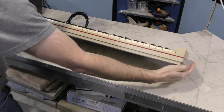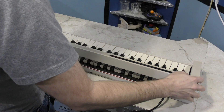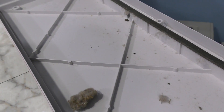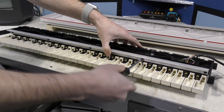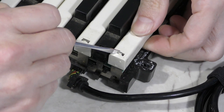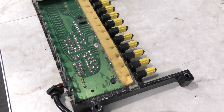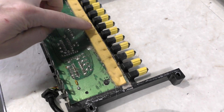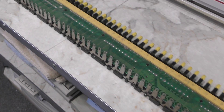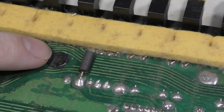But before I do that, there's one other problem to tackle. I'm going to take the keyboard unit apart and see if I can clean the contacts inside. It's pretty easy to take apart — there are just a few Phillips screws on the bottom. The top piece comes off and the keyboard mechanism is now accessible. The inside is pretty dirty, there are dust bunnies everywhere, and it's no surprise it isn't working well. I'll need to remove this metal bar held in by a few screws. The keys pop off by bending little clips back with a screwdriver. I have a significant number of keys removed, but I'm at a loss to figure out where the conductivity takes place — I'm thinking maybe it's under this foam pad. I couldn't remove the PCB because the way it's attached to the frame, they've essentially melted the plastics to hold it down, so I'll have to clean it in place.